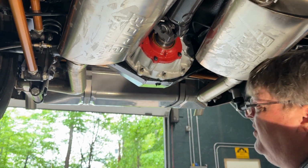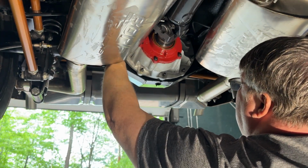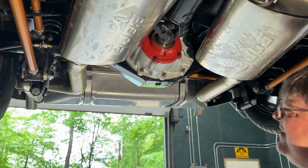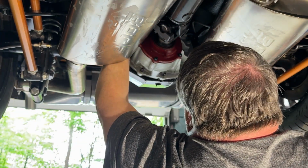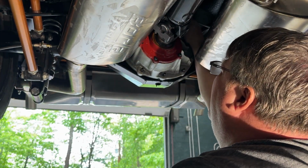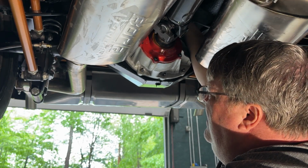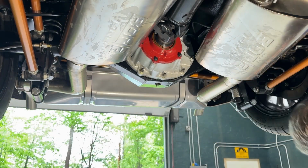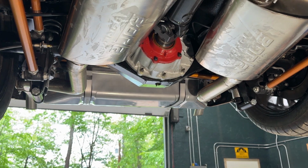Now these bottom two bolts on this differential housing, I had to pry the housing out just a little bit to get those to come off, the bottom two nuts. That's a thing on these original design type clones or whatever you want to call it. They're all new, but all right, first things first, got to get those two bottom ones back on first so that I can close up the gap. Bottom two nuts. These are lock nuts.